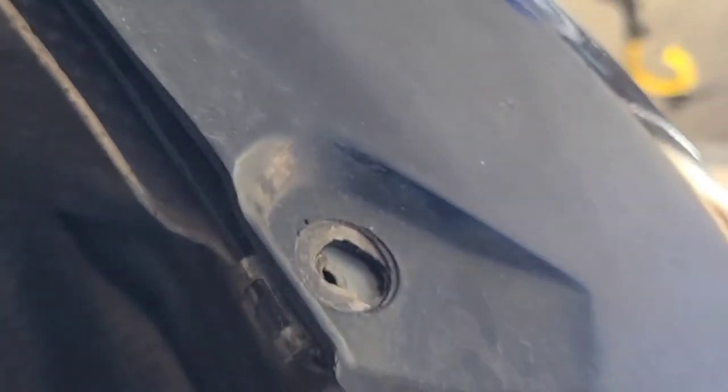I wanted to show a couple more - these are 10 millimeters. I'm literally laying underneath the exhaust tips. These hold the very back center bottom of the bumper cover in place - there's one on each side. I'll go across the exhaust tip to the other one, and there's a third one in the middle that I did some strategic weight reduction on and never put back in. I'll take those three 10 millimeters - or in my case two - off with a long extension so the whole bumper cover will be loose. There are two other attachment points on the driver's side that were T25s, already removed, and obviously the same on the other side.